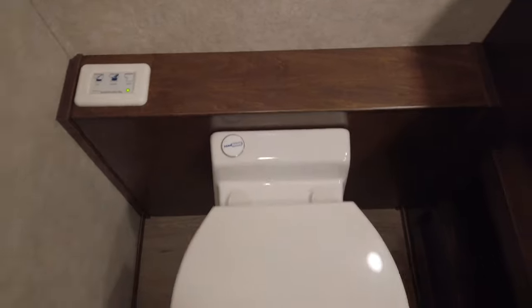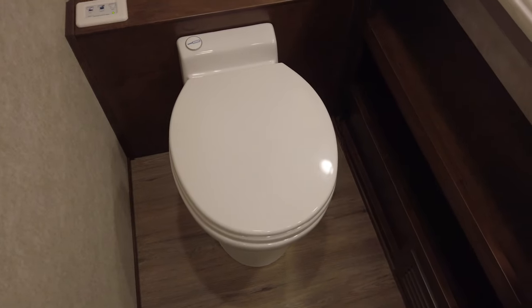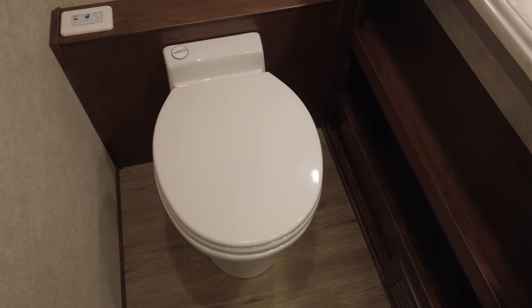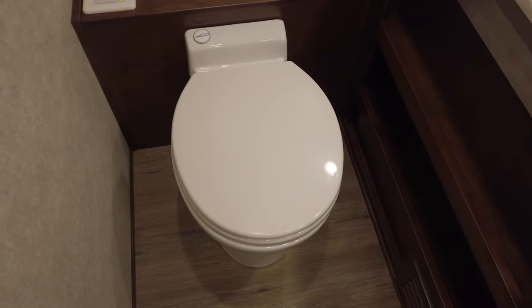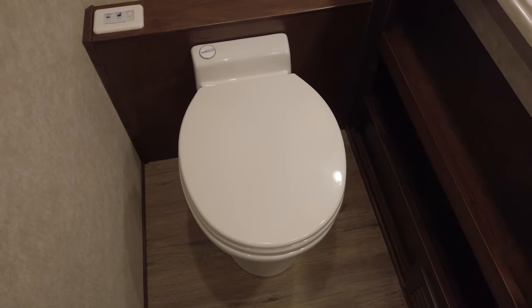You've got another medicine cabinet back here and large cabinet space. The toilets are macerators, so everything that goes through the toilet is ground down and sent to the black tank. The reason for that is it makes it a lot easier to keep those tanks clean. When you go to dump them, you put bacteria in those tanks with a chemical that helps break it down even farther, so you get more of a slurry, watery mix.